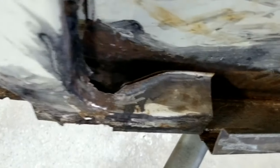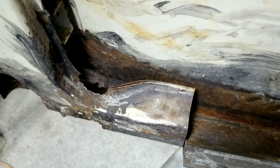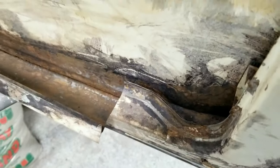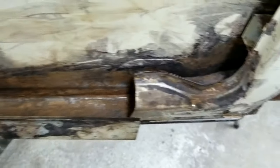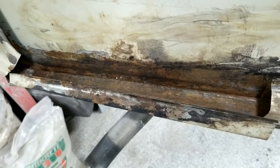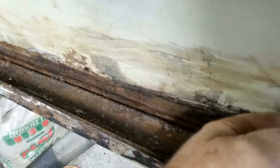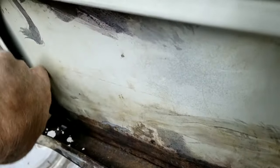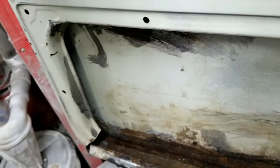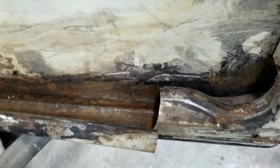Maybe you think if you do a restoration, it's gonna be forever. I don't know. Even the best guys, even if you replaced it, a lot of times they don't even prime this area down in here. In fact, most of the time they don't. So if you're really diligent, you could get one of those 360 degree things and shoot rust curing primer inside behind here. Probably still gonna have voids, even if you do that.